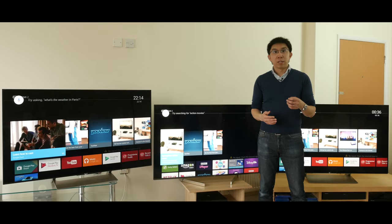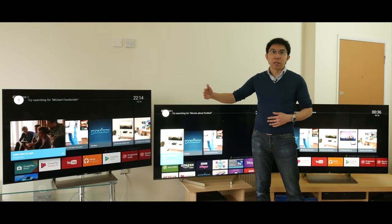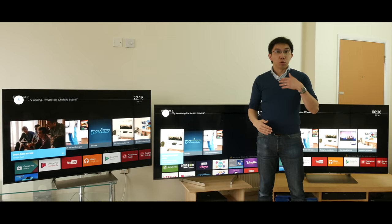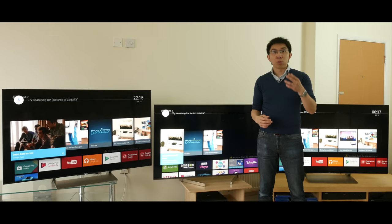If you are seeing some differences in colors, it's partially because of the viewing angle. These are VA type LCD panels whose contrast and colors desaturate off-axis. I have to angle the XE90 and the XE93 slightly to fit them into this video. The camera I'm using to film this video has a limited dynamic range, but these are HDR televisions, so sometimes I have to lower the camera exposure to show all the specular highlight detail, causing the picture to look too dark and shadow detail to disappear. To illustrate blooming or hallowing artifacts, sometimes I have to increase the camera ISO, which introduces noise to the video.